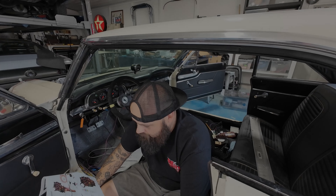Let's see how well this box fits up on here. We got our box mounted. They said to mount it away from engine heat — that's probably as far as I can get it. I wanted to mount it in the glove box, but then I did the unlikely thing and read the directions, and it said don't mount it in an enclosed place like the glove box. The coil is probably going to go right here, so I'll have all my electronics right there. It's going to be pretty sanitary.